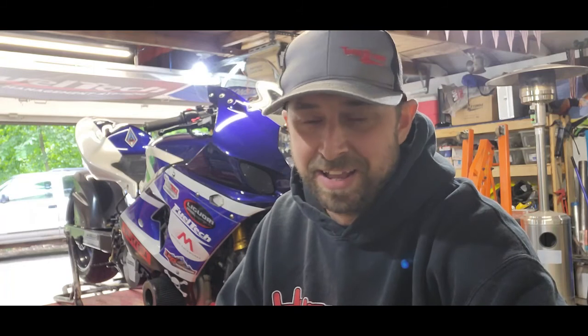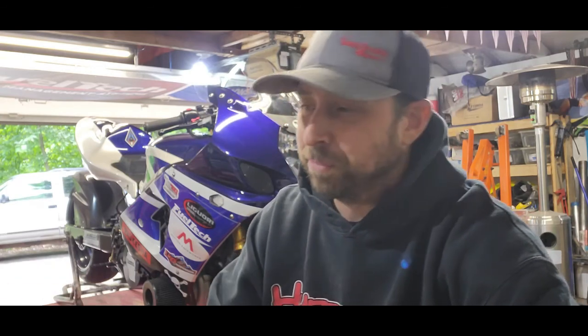There's like six tables to make it idle. It's crazy, the amount of settings. Well, I don't want to get too involved and bore you guys about tuning on a truck, but very minimal of the tuning on that is based on fuel tables. Everything is ignition and torque based and airflow, and that's taken some getting used to, but it's working.